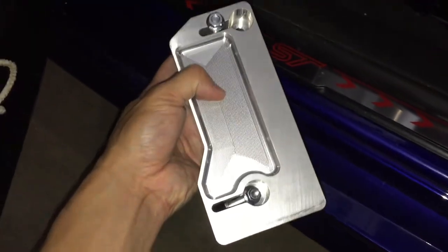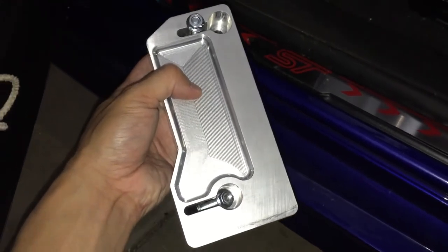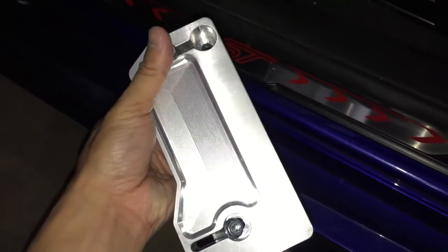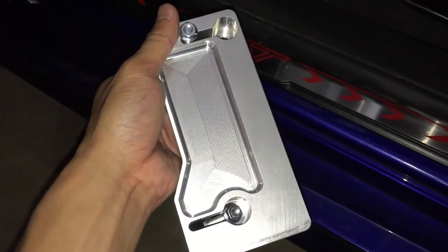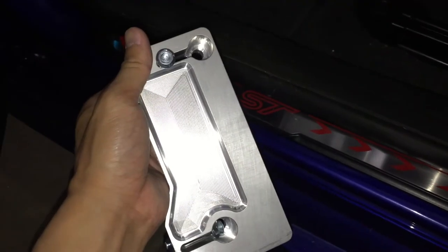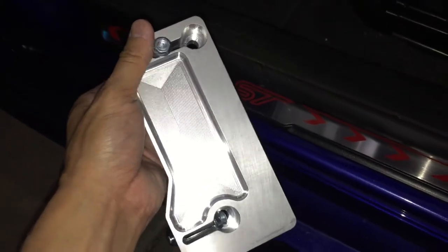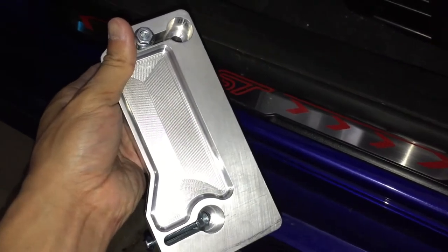What they don't tell you in the final steps: when you're installing this, you should keep the bolts in the back — the ones you'll use to mount the accelerator pedal. The reason is that this sits pretty hard and far up against the firewall, and you won't have much room to put it back on and screw those top bolts into the accelerator pedal.